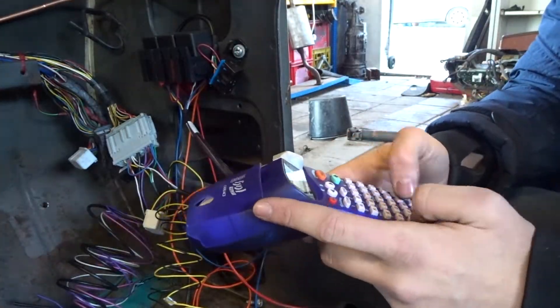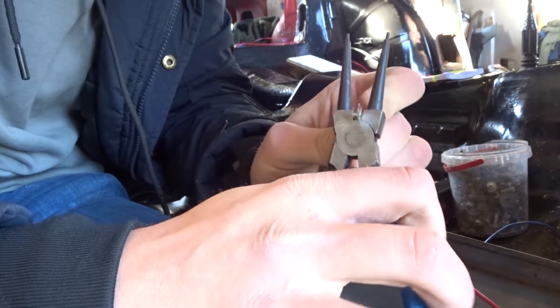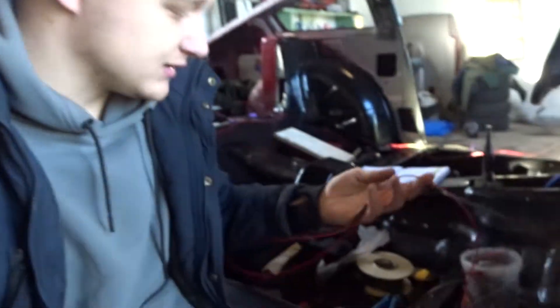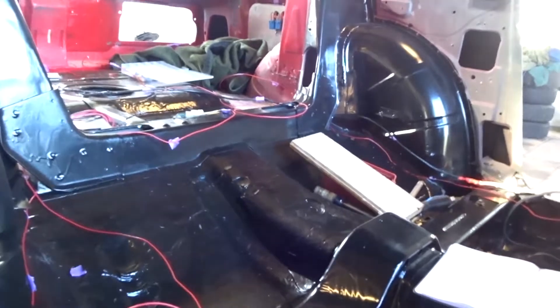After I figured out which wire went where, I started labeling the wires. I bought this label wire on eBay for a few dollars and it made my job so much easier — I could label every wire and make sure I would not forget where each one goes. After this, I started wiring the wires I could, like the fuel pump and the 12 volt to the main relay. I wired these two wires — the blue and the red one — the main 12 volt and this one going to my fuel pump in the back. The connector is right there. So the next step is probably more wiring, but this is it for this video. This is more like a how-to wire any K engine in any harness. Give a thumbs up if you liked the video and I'll see you in the next one.